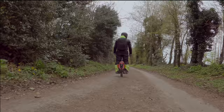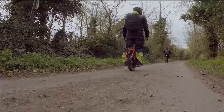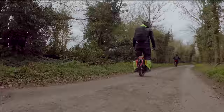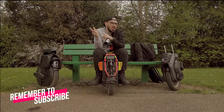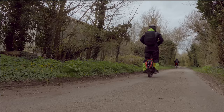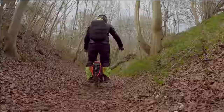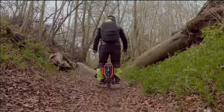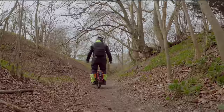When you go off-road with the S20 you really enjoy this wheel, but it comes with a big problem: braking. I don't think it's just a software problem — the hardware is not prepared to achieve good braking. At 126 volts, the wheel isn't even at full charge since they deliberately avoid that, because when you brake you're sending voltage back into the wheel. I think since the beginning they knew something was wrong. Even on a slightly downhill surface, you struggle to brake or control your speed reduction.